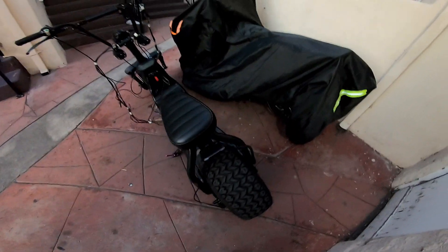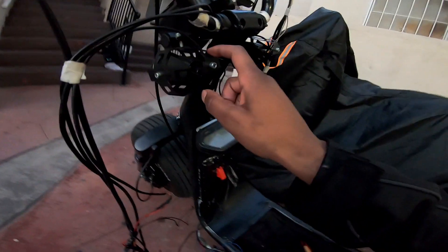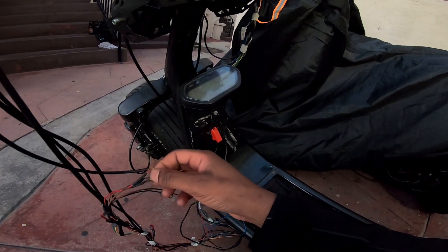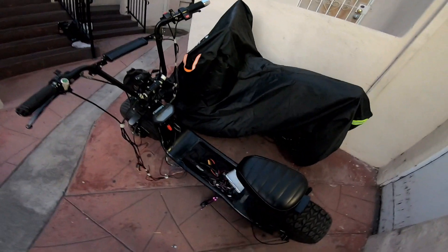That's my brakes — I hit that and the brake light lights up. Here's the jumble of wires coming out. When you're wiring up the lights, if you want the halos to work on these, you wire the yellow into the constant positive and you wire the red onto your switch. That way when you hit the switch it lights up the inside lights. Since I just rewired it, we're about to take it for a quick spin.